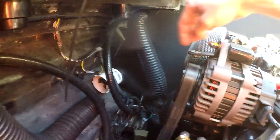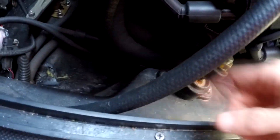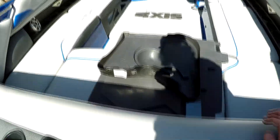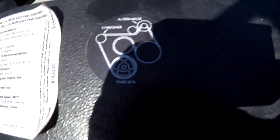We've got our housing off, which basically is one bolt on top and two flatheads that you can use a finger grip on or an actual flathead. You can access the drive belt right there. Here's your water impeller right here. Here is your drain hose for your oil, which goes all the way back down into the oil pan, down on the very bottom of the block. Obviously your filter. Make sure you don't lose these little prongs — these happen to fall out a lot of times, and you're screwed if it does, because that's where the thread goes into. Whenever you look at your little plastic protector, you can see where the belt should go, so make sure you bear in mind the belt direction when putting it all back together. This is all your information about the engine — recommended oil, firing order, all that kind of stuff.